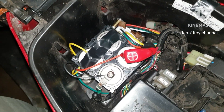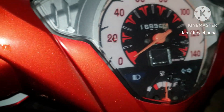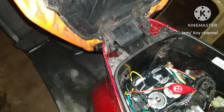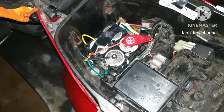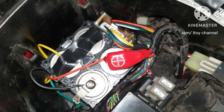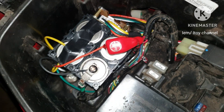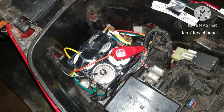This is a 12-volt battery with about 6 amp hours capacity. I already started the engine and we will see if it shuts down. It will not, because the battery is used to start the engine only. Power is now supplied by the engine at around 14 volts, which is tolerable by the LiFePO4 battery. The engine is now charging the battery.